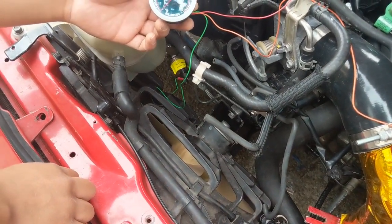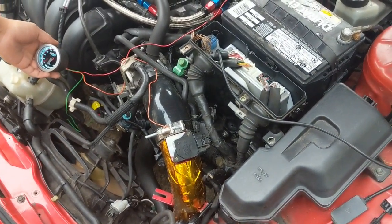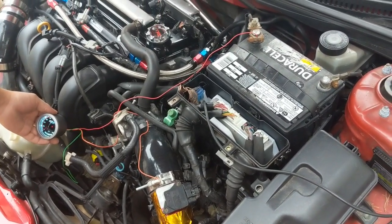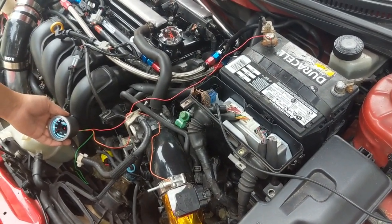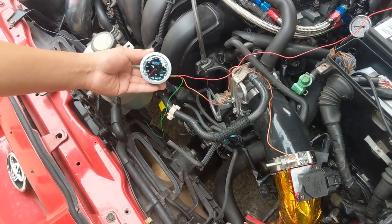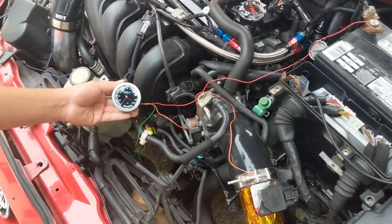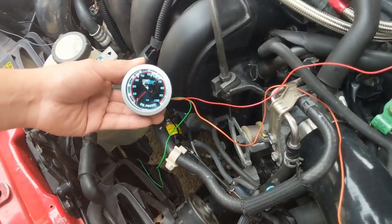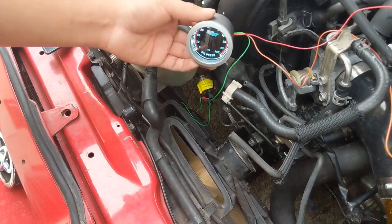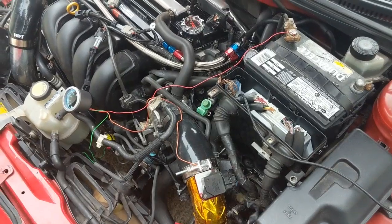The gauge isn't reading - I don't know if it's because it doesn't have oil on it. There's no oil pressure. Why? Because we drained the oil - the engine was apart, we need to build it up. I'll keep going then because nothing's going up. Stop - it's not even moving a bit. Yeah, it's not moving. Now let's check for leaks, try number two.